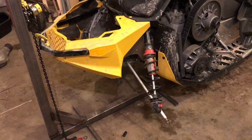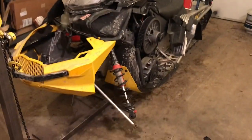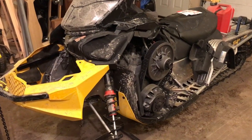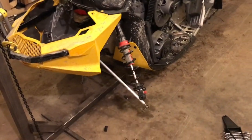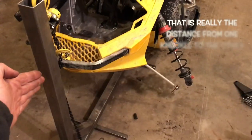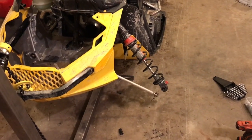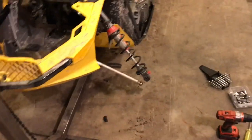Time to get down to business. We're shortening the a-arms on a Ski-Doo RevXP 154 — Summit XRS 800, Rotax 800R P-Tek, 2010. That's about all the information on it, but the front suspension is pretty standard. This sled originally sat at 42 inches and we're trying to take it down to 37 — that's the distance from the centerline of the machine out to the pivot of the knuckle. So 42 to 37 is five inches total, two and a half inches per side.